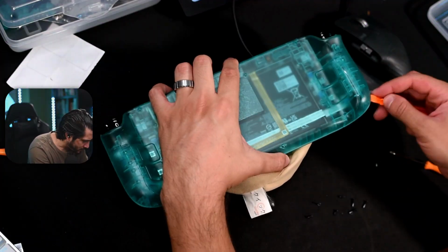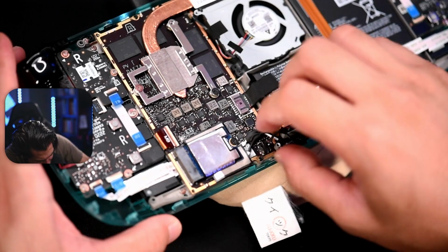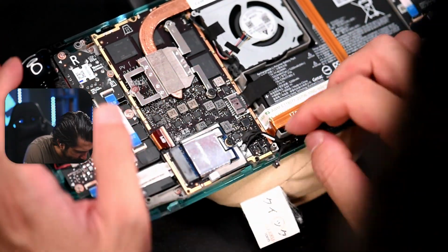So I had to put my deck down, open up the back cover, pop it off. I didn't have to undo everything, but I did enough to get back to that speaker connection. So what I did is I pulled the wire out of the little hooks, little grooves, and I followed it really closely, and I found there was a little indent in the middle of the wires, like a fingernail indent, and nothing was cut or sliced. It was just indented, and there are 2 little slight bulges on each end of the indent.